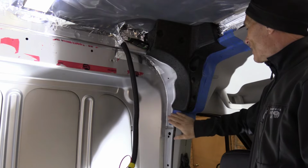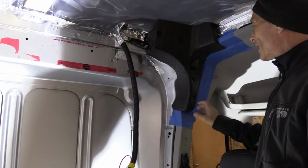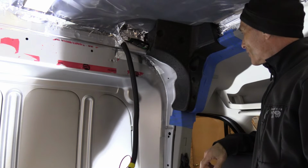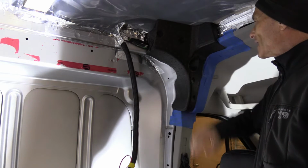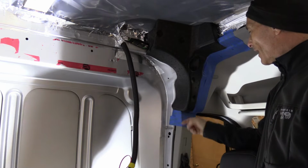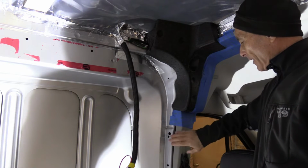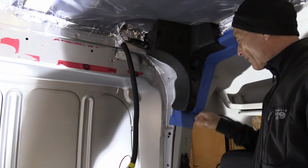And I've already masked the headliner, so when I come to spray the contact cement on the foam blob, I won't overspray on the headliner. And the trick is in wrapping fabric all around so that when it's done it looks nice. But like the main part here and underneath here by the pillar, that's a bit tricky because there's quite a sharp angle. So I've already pulled the plastic cover for the pillar, just enough that I can push the fabric behind.